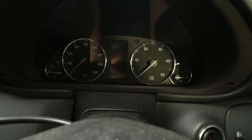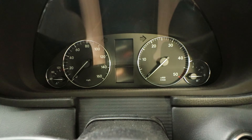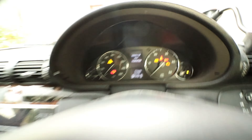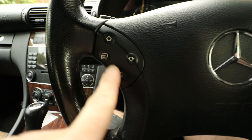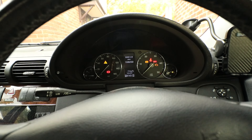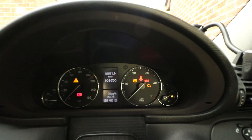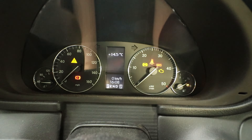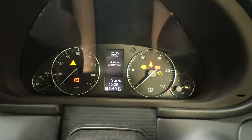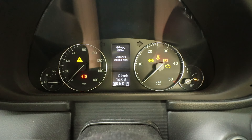It's a bit different because I was always told to check engine oil when warm growing up, but there you go. Don't start the car — just turn the ignition on to the point where you get all the warning lights. You want to be on the main menu; you can navigate through with these buttons — top level menus for mileage, settings, audio, etc. Scroll to where your miles are displayed, then go through the sub-menu until you get to the oil level option. It may say 'observe waiting time.'